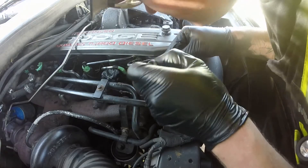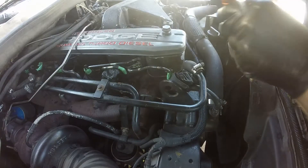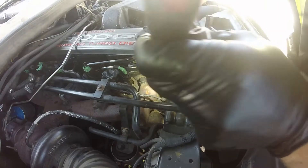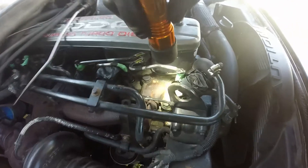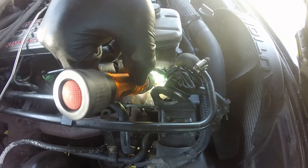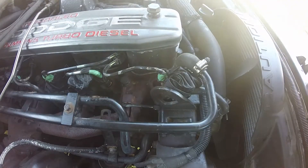And I think I dropped it. There's a prime example — if you look down in the cylinder the gasket has actually turned sideways, so if we were to put pressure on it all we're going to do is wreck it.